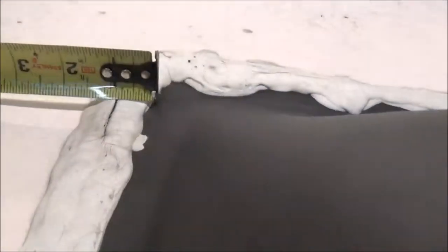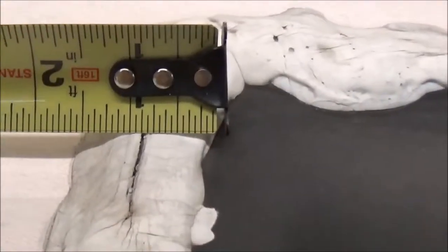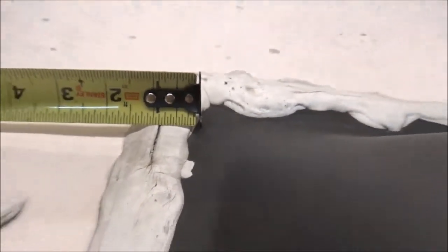Look at these ones around the refrigerator vent. That's what this is, refrigerator vent. Right there, you can see those cracks all around there. Got a good one right here. Now look how much that is. All right, let's just take a gander at this. I'm just curious how wide that is. It looks like it's about 1.5 inches to me. Yep. You got 1.5 inches of caulking on that thing and it still isn't staying.